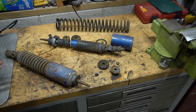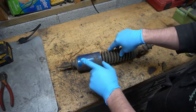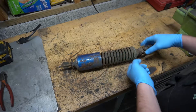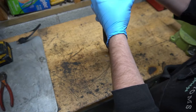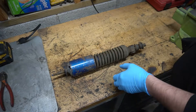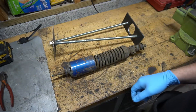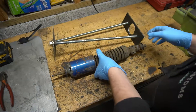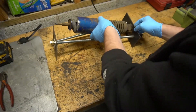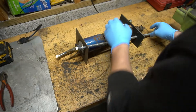It's not difficult, but it's a little sketchy. Motorcycle shops should be able to do this since some motorcycles use a very similar spring type. I'll show you what I made: two pieces of half-inch all-thread and some spare steel plate from around the garage. This sits down in there like that, and this one grabs the top side to compress it.